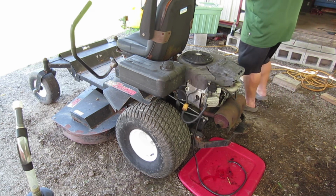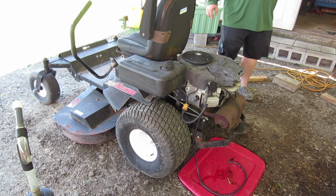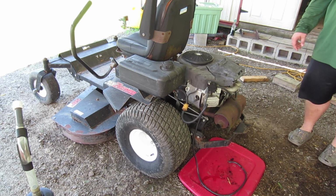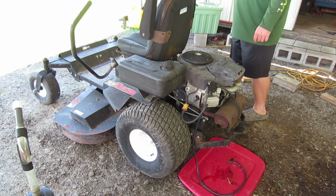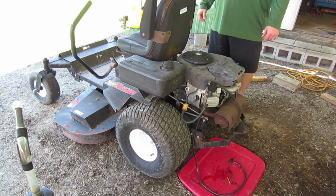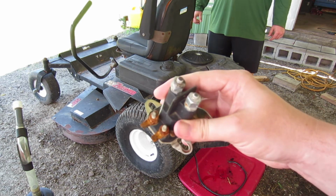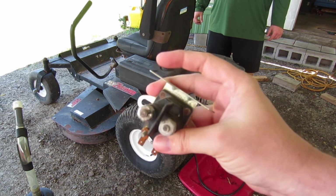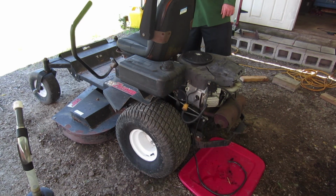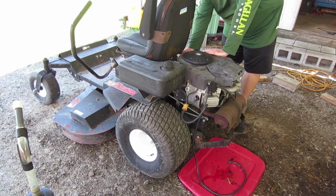We poured about a quarter cup of fuel into the gas tank and it started leaking. So it looks like the little petcock on the bottom has a gasket that's gotten roached out and didn't want to seal anymore. And the petcock itself was frozen, so I ordered a replacement on Amazon, as you do. So that's in. But in the meantime, we did replace the solenoid. It was pretty crusty, especially these bottom two terminals. So, try to start it with the key.